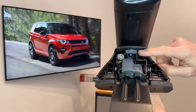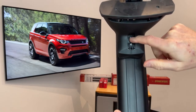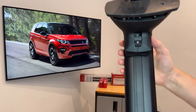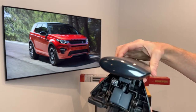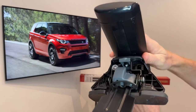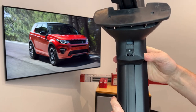The first attachment is underneath this panel, and that gives us access to the fastener that holds the tower to the bar. That fastener also is a pitch adjustment which will help to compensate for curvature in the roof of the vehicle. When I close this panel, you'll see how it prevents access to that fastener for security.